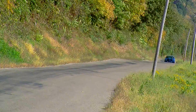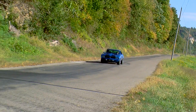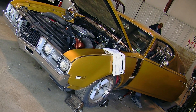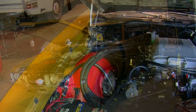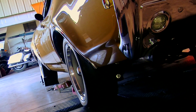None of these pieces had ever been assembled together until we built this car. When you build a car from nothing, you have a bunch of variables — do the brakes work? Does the steering work, in addition to does the engine work? So a lot of times we'll take a freshly completed car or a car that's halfway through the build process and take it to the dyno shop, where we can effectively drive it on the rollers without having to worry about steering or monitoring gauges while driving. We eliminate the variables of brakes not working and alignment issues, and focus on engine and driveline performance alone. It makes it easier to break in a car on the dyno, and it's a lot safer.